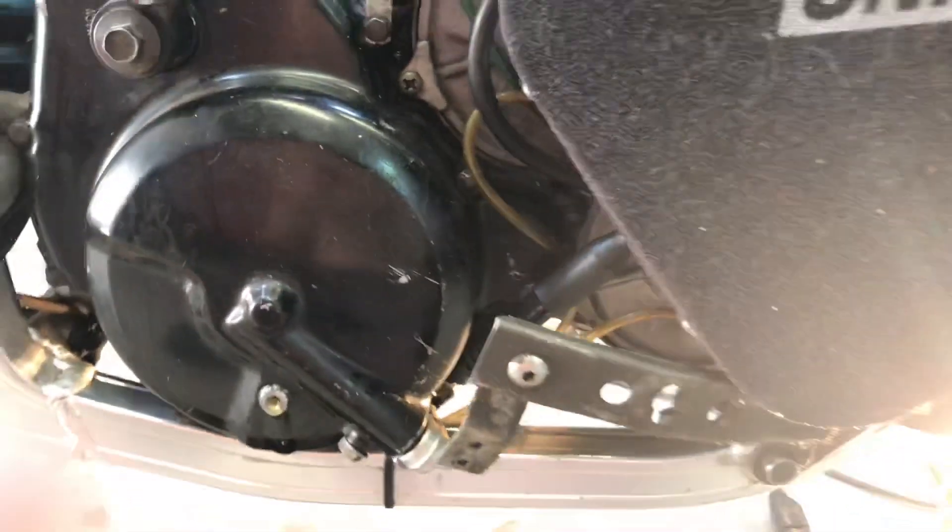A friend of mine, Pat Hennon, mentioned that when racing his RG500 in Europe, he had to change the gearbox oil constantly because of the crankshaft bearing thing — the front bearings draw on the transmission oil and contaminate it more quickly.